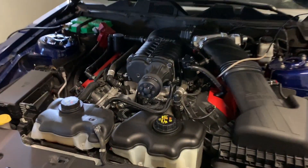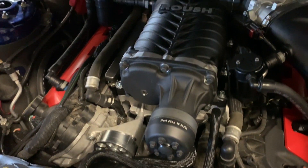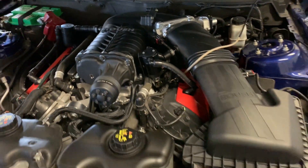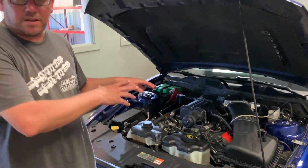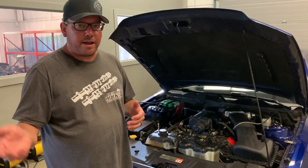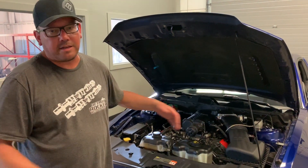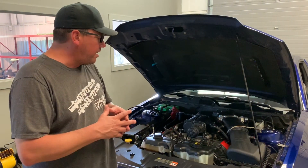As always, we want to do cooling mods. We are running the AFCO high-flow radiator with a rear cylinder head cooling kit. For those of you looking for more than 560 to the tires — maybe you have a package like this already, or maybe you like this Roush TVS package because of torque instant — but you're wanting about 600, maybe a little bit higher, that's when you're going to add the open air induction system and a new calibration that can take advantage of all the airflow.